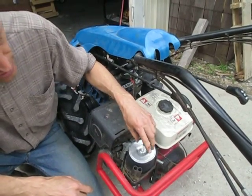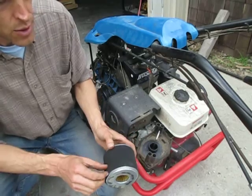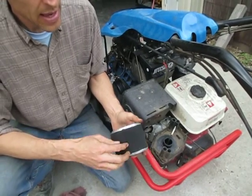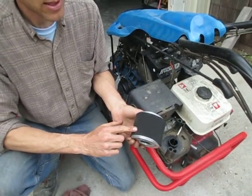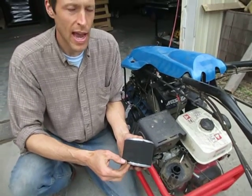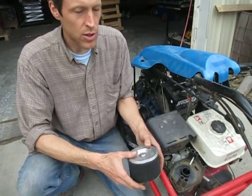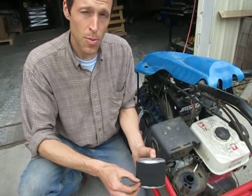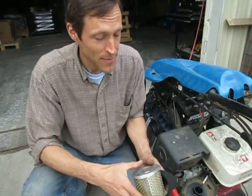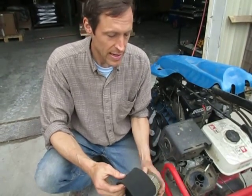This is a typical small engine filter setup where you've got a two-stage air cleaner. Two-stage meaning there's a foam outer wrap and then a paper pleated element inside. The job of the foam filter is to stop most of the dust before it gets into the paper, and the only way the foam can effectively do this is if the foam is actually oiled — it's designed to be slightly oil-wetted. This particular tractor came in for service and was owned by somebody who apparently didn't know that, because the foam is completely dry. The dust would have gone right through.